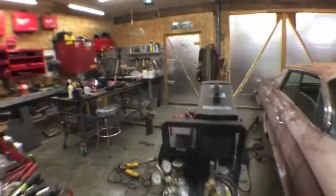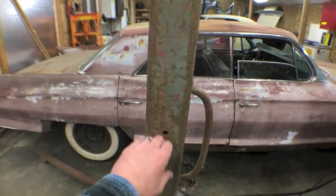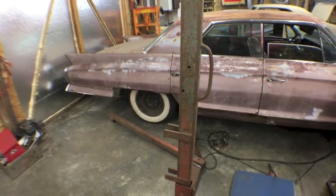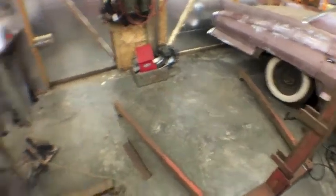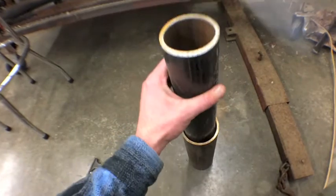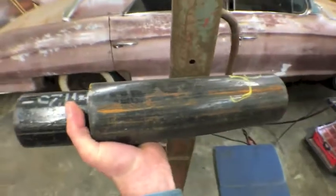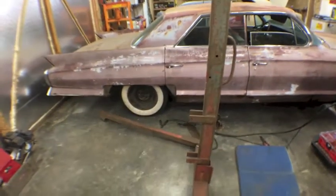The tricky thing too is when I cut this and put the pipe on for the rotisserie part of this side, it's key to make sure this is perfectly level — if it's at an angle it's going to bind up. I'm going to do this pretty archaic: just tube in tube, grease it up, figuring I'll have a couple good friends to help. The body itself without anything on it doesn't weigh a whole lot. I was thinking about bushings and brackets but I figure tube in tube — this will slide inside here, get welded, and this part will spin inside it. I'll put a big lever arm on this side and create a stop for it. I also have to build bracketry to mount to the car body — that'll come later. This is the first side.